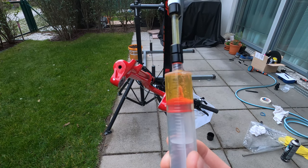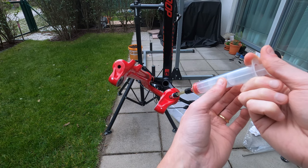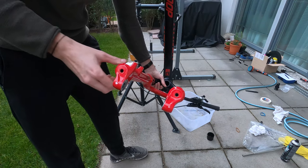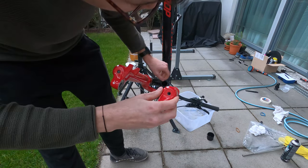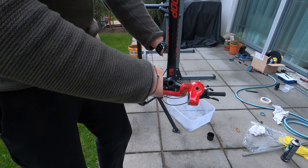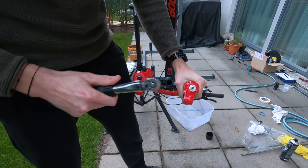Now fill your syringe from the oil used to refresh the foam rings and inject 10 ml of RockShox 0w30 suspension oil into each lower leg through the bottom bolt holes. After that, slide the lower leg assembly toward the crown until it stops. The spring and damper shafts should be visible through the bottom bolt holes. Install the black bottom bolt into the spring side shaft and the silver bottom bolt into the damper side shaft, both torqued to 7.3 Nm.